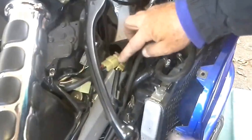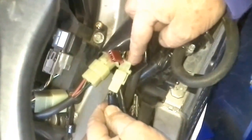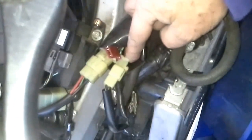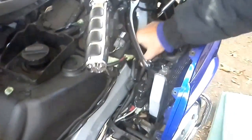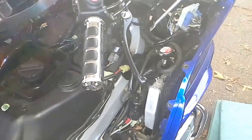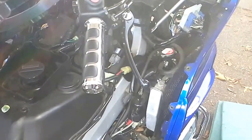Let's show them what the actual problem was. This is factory — this thing has never been apart before. This connector was still connected here, but twisted out of the socket. To determine it was the relay switch, we found out there was only one relay, and the other fan was working, so we knew it was an electrical problem or a motor problem.